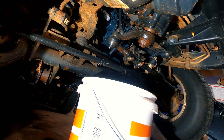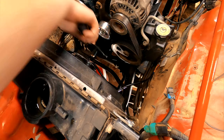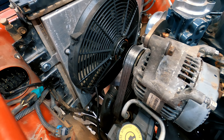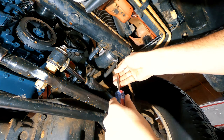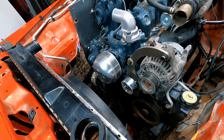Moving back underneath the Wrangler, I completely removed the drain plug from the radiator to get the remainder of the coolant. After that I put the front of the Wrangler on the jack stand and removed the jack so I'd have better access to the lower radiator hose. Because of the serpentine belt, getting the hose off is a little bit of a trick — you have to take the top clamp off from the top and the bottom clamp off from underneath the Wrangler. Next I loosened the tensioner pulley to remove the belt.